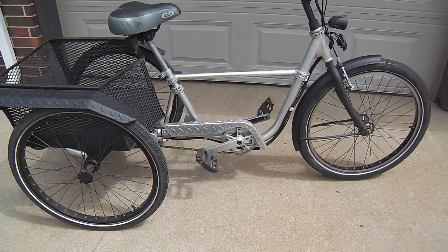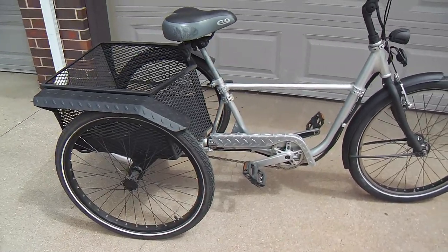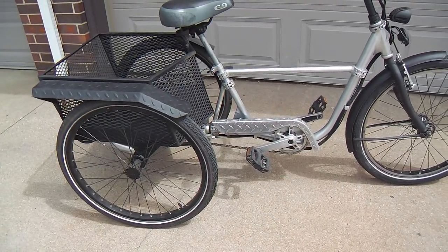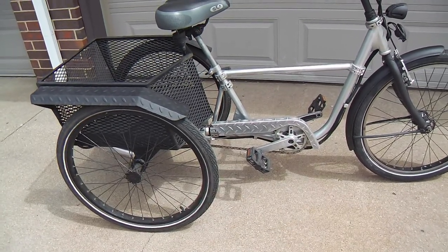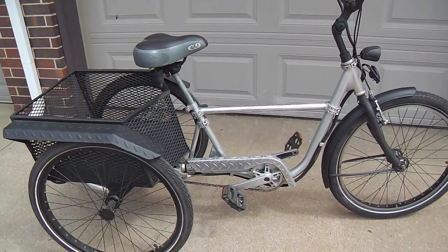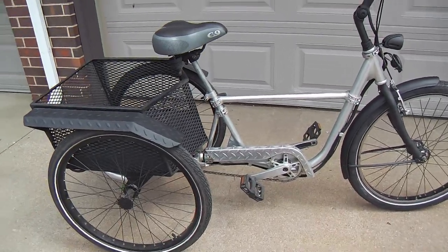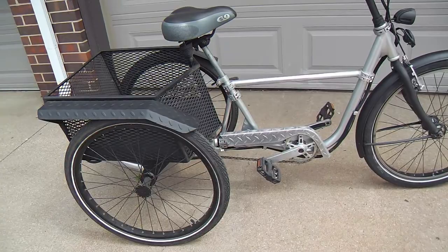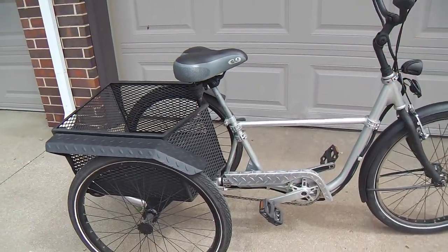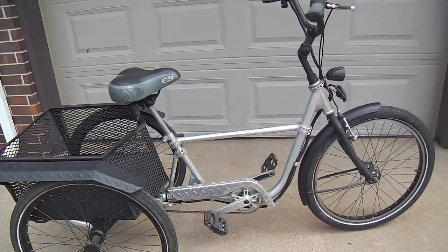And so here's that other trike I did. This started out as a single speed, off the shelf trike that I narrowed the tail section so you can get through interior doors and rework that whole tail section. I thought I could shoehorn a five speed internal hub into it, but it wouldn't accept it, so I had to rework that whole tail, and now it's a five speed. It used to be electrified for a while, but I didn't like how it was driven from the one wheel. It was a powerful motor, and it really had some torque steer on takeoff, and I didn't like that so much. But I lived with it for a while, and I had another little platform seat that I could swap on if I wanted to use this for myself as a backup, and I did that once or twice. But now I reverted back to it just being a regular pedal trike only.